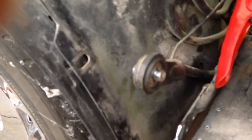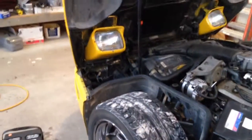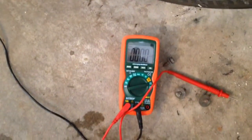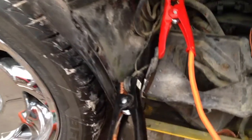As we take the black cable and connect it up to this lead, we would expect to hear the light motors run — and we do, and then they will stop. The reason we needed to do that is that it would likely pull more than 10 amps and probably blow a fuse in this volt-ohm meter.